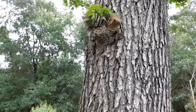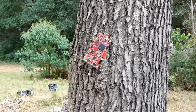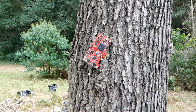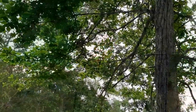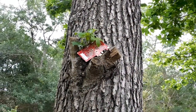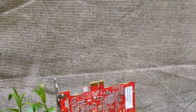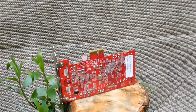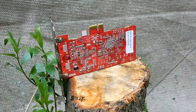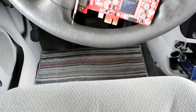I got it set up in OBS Studio, and I found that I could not input my camera's output to this card, as it does not support HDCP, which is pretty vital. I don't know if Elgato supports this, but if you're looking for that, you should look further, because this is not the card for that. I also found it does not take very low resolutions. For example, my 1440x900p monitor from like 2005 could not input to this capture card.